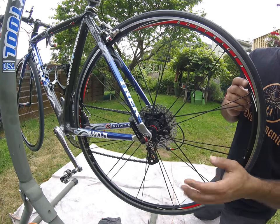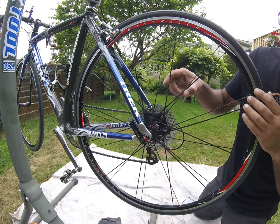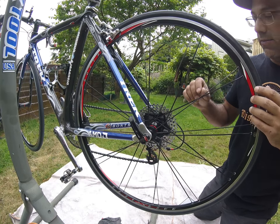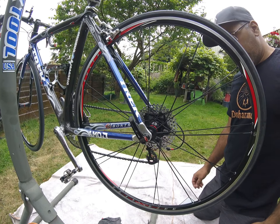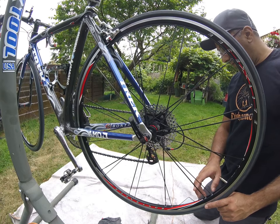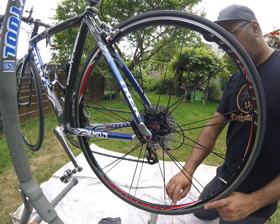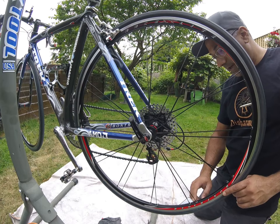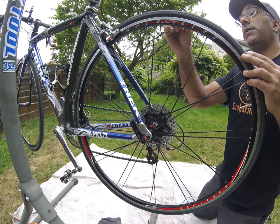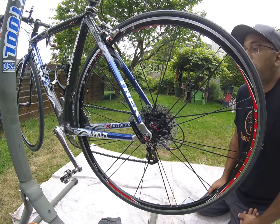Beautiful spokes, radial laced, non-drive side. They've got a cross on this side. Thicker bladed spokes on the drive side, slightly thinner bladed spokes on the other side. They're paired, I believe it's 24-20. And the common problem with these wheels that I've seen in the past is they fracture along this pair, but like I said, it's absolutely mint. And yeah, I'm not the lightest guy, but I'm not the heaviest, and I keep my tires inflated, and I don't anticipate any problems.